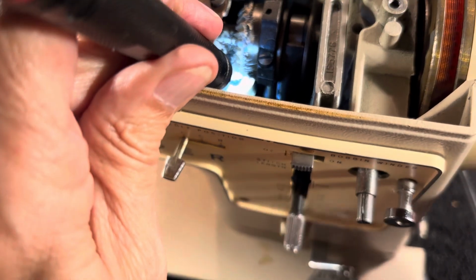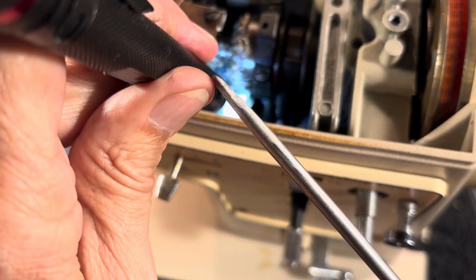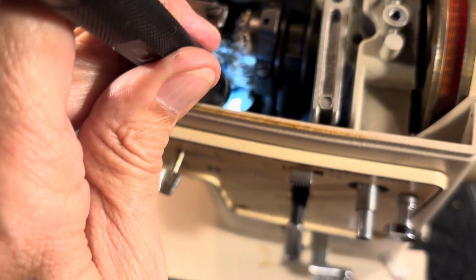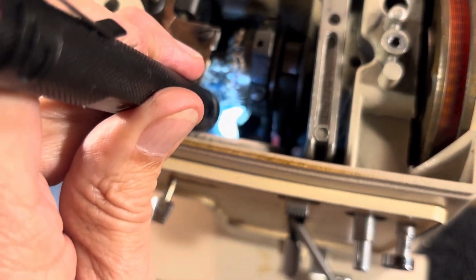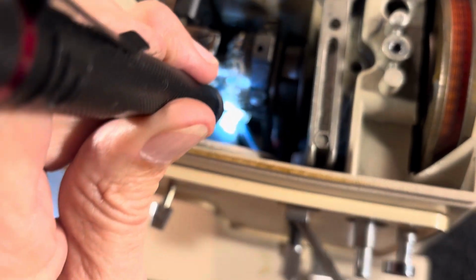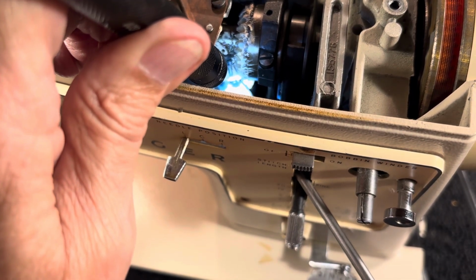See, there's your set screw in there. And make sure your screwdriver is the right size so it fits flush. Got to be small enough to go through. It's got to be a good quality screwdriver, and I'm always harping on quality screwdrivers. Sometimes you get one chance at these screws, and if you deform them with a bad screwdriver, it's game over. You see the slot in there,